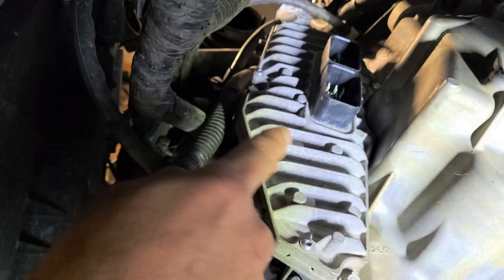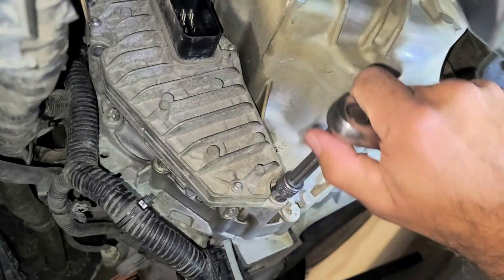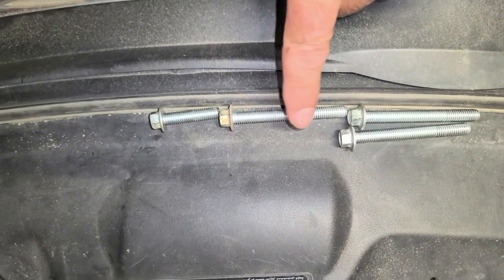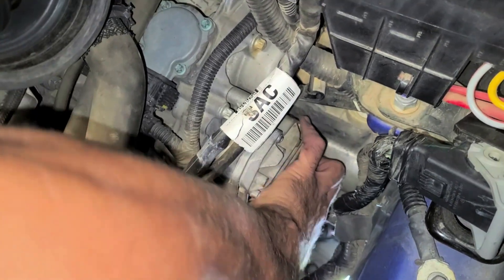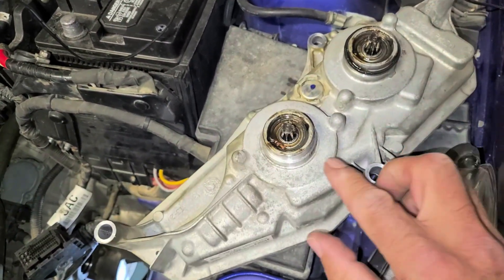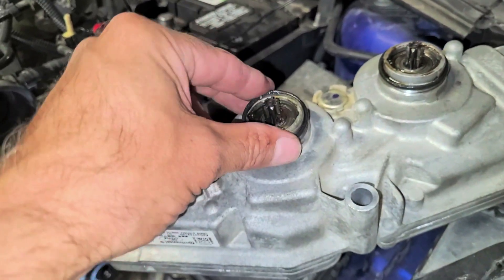Now the 10mm mounting bolts for the TCM can be removed — there should be four in total: one at the bottom, one on each side, and one at the top. I found it was easiest to remove the bottom and side bolts from underneath the car. There is one bolt that is a little bit shorter than the rest, so keep track of its location. Now the TCM is ready to be removed — just grab it by hand and wiggle it while pulling out at the same time. Once it's popped loose, finesse it out of there because it is kind of a tight fit. When removing it, make sure that both O-rings come off with the TCM. One of them may stay inside the hole, so go ahead and grab that, otherwise it will cause issues when installing the new TCM.